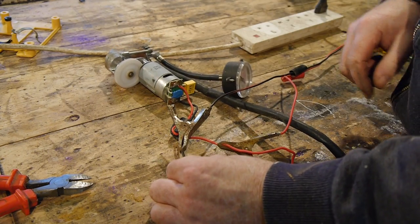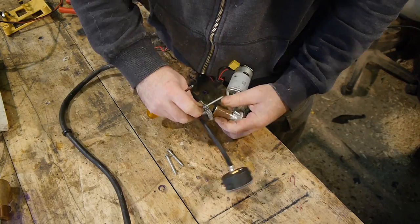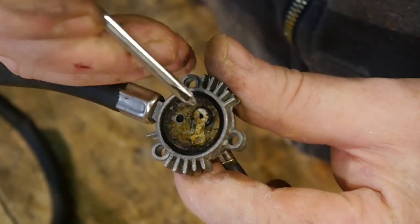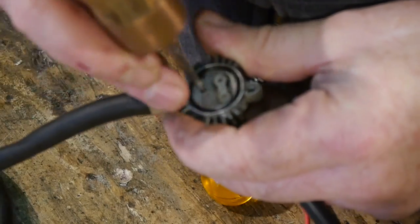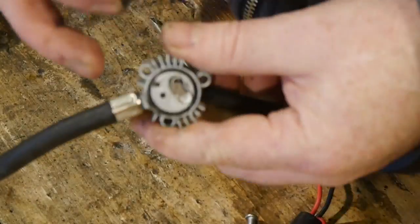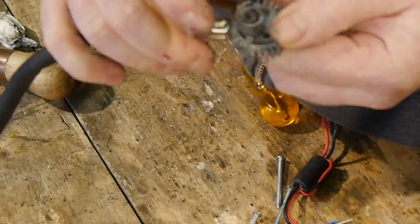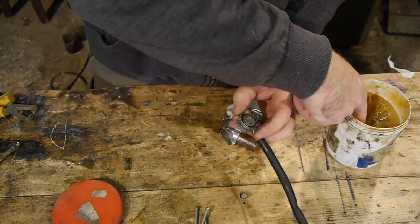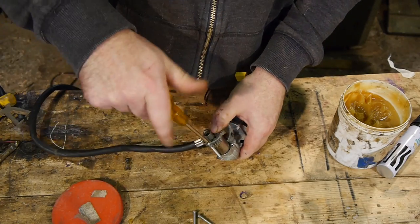First I check to see if my pump is actually running. The motor is running fine but the pump doesn't actually create any pressure, so I take it apart to see what's going on. From the small DC motor there's a geared mechanism which pushes a little piston inside a cylinder. At the top of the cylinder there are two valves — one on the outside held by a spring which allows air down the tube into your car tyre, and one spring-loaded on the inside with a small rubber plug that prevents air blowing back out. The problem was the inlet valve was letting air back out, so I tension up the spring by pushing it back into place. Everything gets a coat of grease and I sand the cylinder to get the rust off.